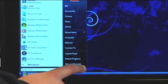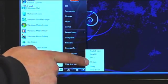If that doesn't work, you're going to want to try and restart the computer. Save all the stuff that you're working on — always save — and try and close as much as you can. Then click the Start button; there's an arrow next to the lock, click that, and you'll see it says Restart. Restart your computer, then relaunch your applications — not quite as many as before — and hopefully things will be working normally.